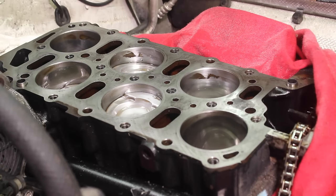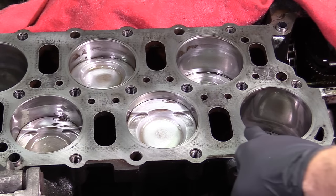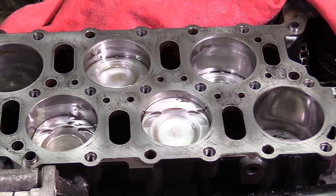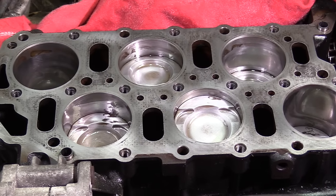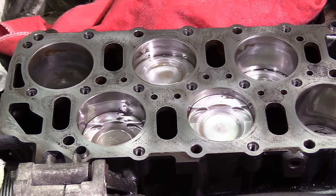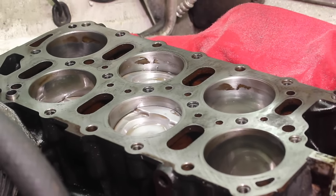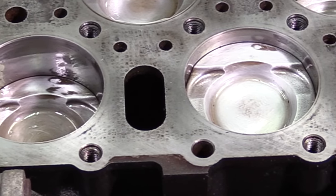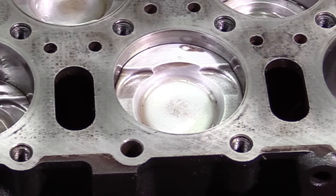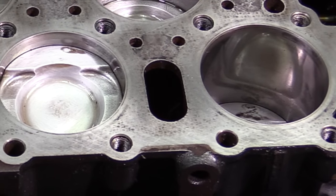All right, so there we have it. All of our carbon is gone from our pistons, our cylinder walls, and our head gasket surface. Now there are a couple of spots that didn't come perfectly clean, but remember this is not the last time we are going to be touching the surface — before the head gasket goes on, we're going to be doing one final cleaning of all of this. This was just to make sure that we got an initial clean and to take our measurements with a straight edge and feeler gauge to be sure that the block's not warped. I have yet to see a Volkswagen block warped — even when the head gasket fails and the car's driven to the point of overheating and the heads are warped, I've never seen one of our blocks warped. These VR blocks are pretty dang strong.